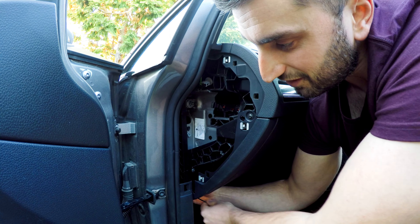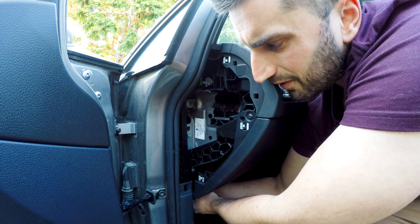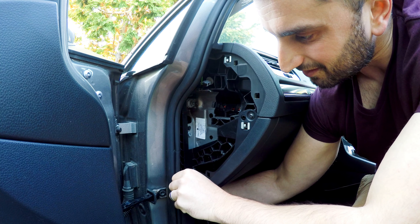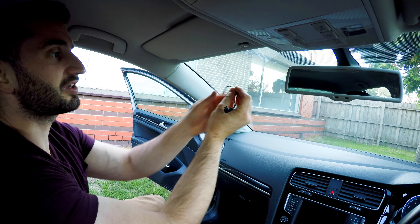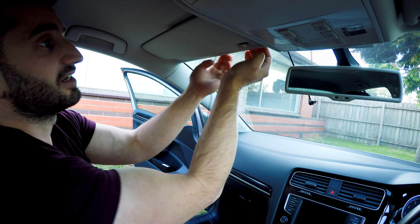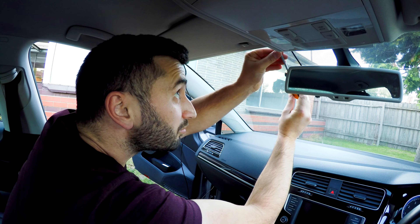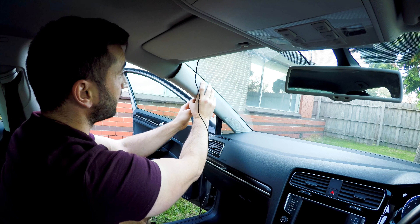You can do the same technique — just feed and then grab. I'm trying to get my finger in there; small hands will work immensely in this job. I've got big fat fingers. With your cable, work out how much you need with your dash cam — I need about this much. Then you can go ahead and squeeze it all in the top. If it doesn't quite squeeze in there, grab a flathead screwdriver and very gently pop the wire in there. You'll squeeze it in — pry the side pillar cover out slightly.